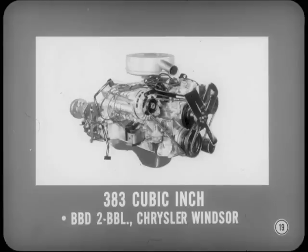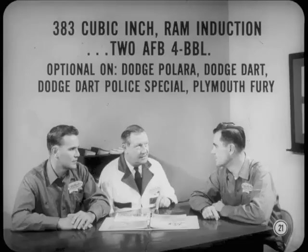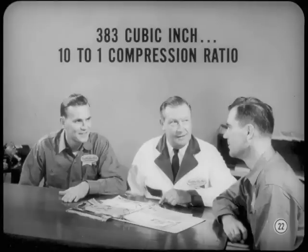Now, the 383 cubic inch engine is also back. It has a Carter BBD two-barrel carburetor and is standard on the Chrysler Windsor model. The same 383 cubic inch engine with a Carter AFB four-barrel carburetor is optional on Plymouth, Dodge Polara, and on Dodge Dart police cars. And there's a 383 cubic inch engine with ram induction and two Carter AFB four-barrel carburetors. This is an option on the Dodge Polara, Dodge Dart, and on the Dodge Dart police special. On the Plymouth Fury, this engine is also known as the Sonoramic Commando. Now, all of the 383 cubic inch engines have the high compression ratio of 10-to-1.